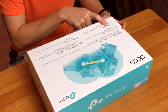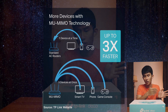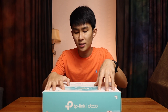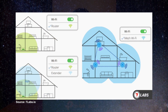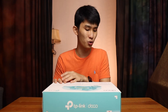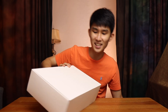On the back we can see AC wi-fi with Wave 2 MU-MIMO — multi-user multi-input multi-output — which means the router can dedicate a connection to multiple devices simultaneously rather than just switching quickly between them. One of the key selling points of a mesh wi-fi system like this is seamless roaming with one single wi-fi name, or two if you have guest mode on. No matter where you are, you only connect to one wi-fi — you don't have to remember to switch to the extender.